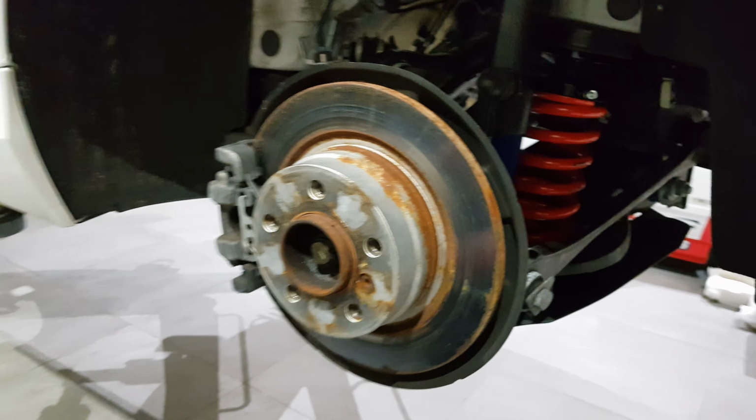So it's a coilover spring on the rear, well, all round actually, and you can adjust your ride height just by moving the preload up and down. Then you've got your damper here, and like you said, it's just the one-way adjustable. At the top here, you've got the adjuster, and you turn it clockwise or anti-clockwise depending on how you want to adjust it. It is only one way, but it does adjust in two ways. It does rebound and compression both in the same adjustment.